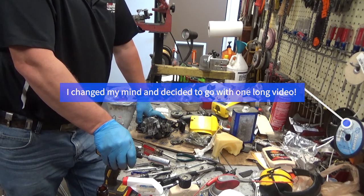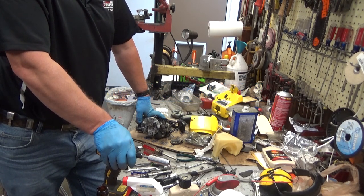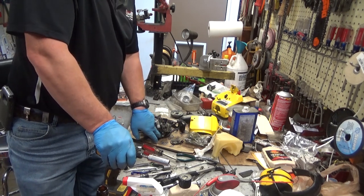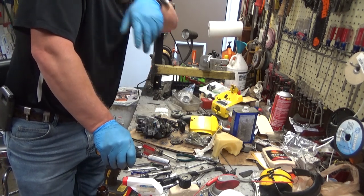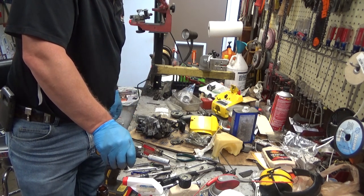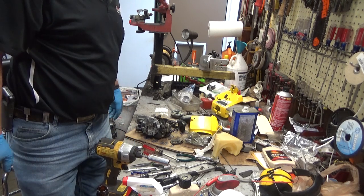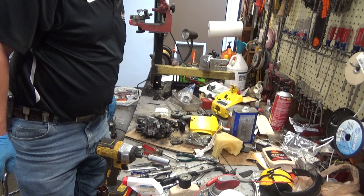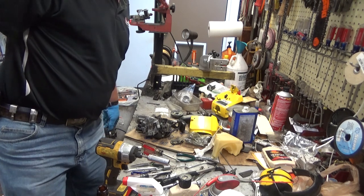If I've got an electronic ignition module up here, I might just go ahead and wire it in, and that way I can test to make sure the coil itself isn't the issue, because just doing parts replacements is no fun, especially when you're the owner who has to pay for whatever it ends up being. So I'm gonna try and do this the smart way. Like I say, we'll report back as soon as possible.